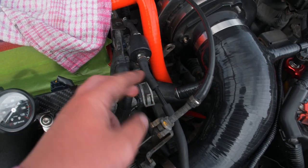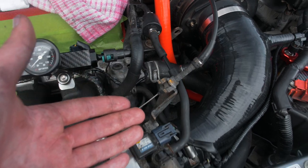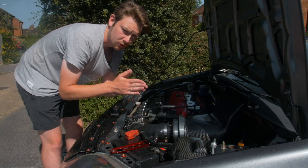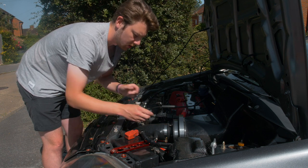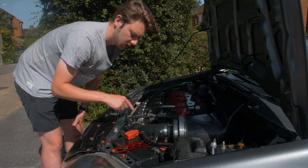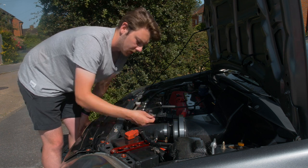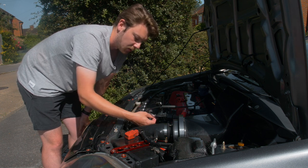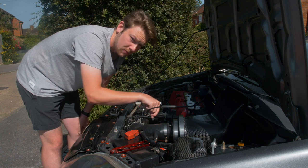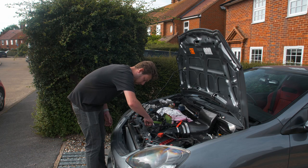That's now extended - it doesn't actually look too bad. I may get a full hose that's this size because it might look a bit better. To explain why I haven't just replaced the whole hose: Honda designed this so that one end of the hose is wider than the other. The plastic pipe in the middle is actually from a Land Rover Defender vacuum line - it's got a 6mm outside diameter with a 4mm inside diameter, which makes a nice tight fit inside the pipe.